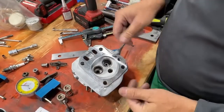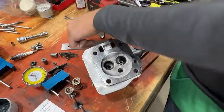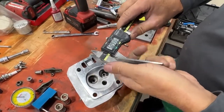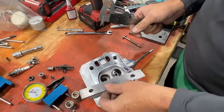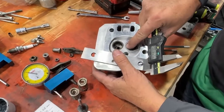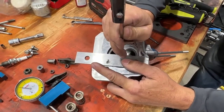But you don't want to do that because they're going to measure. We're at the minimum number here, which means we're probably going to be at other minimum numbers. Now, the quick and dirty way to measure this: I have this flat bar, and I'm going to put my caliper on the flat bar and zero it. Now it's taking up that distance. My first measurement is to the valve seat — that is the valve seat right there. This isn't the most perfect way, but it's going to give us a number.